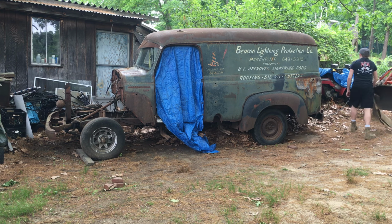But once I get that angle, I'll weld it in down here. I'll probably cut this right here because that's what's left of the actual edge that's supposed to be there. Right up here. That's the edge that's supposed to be here. So I'm going to cut it right here and then weld it down the bottom. Do a couple of tacks right here because that gives us the amount out it's supposed to be from this area that's all gone. And then I'll probably tack it up here where it meets where the hood starts going in, because that's another area that's still there. It's not great, it's not strong, but it gives us the roundabout area where that piece needs to be. And then I'll weld that, and then I'll get to this whole missing area right here after that.